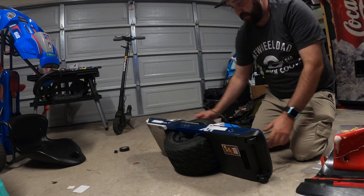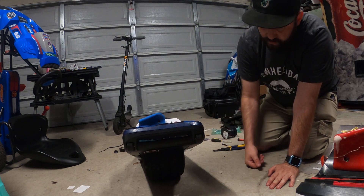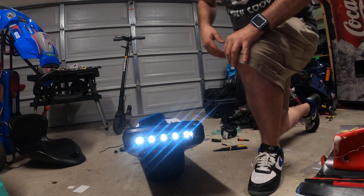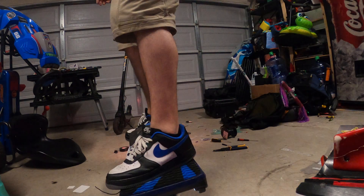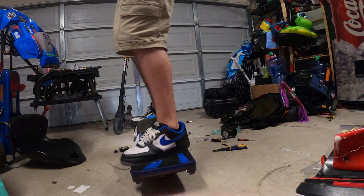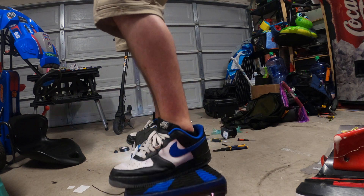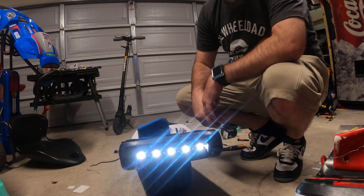Make sure the wire is in there tight, then turn your board on — boom, now my board's on. I hop on my board and it stays on, stays engaged, just as long as you've got all that wire touching the pins. That's the only fix I've been able to find so far.